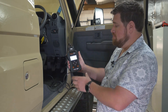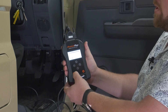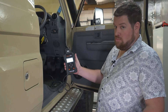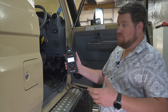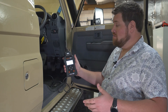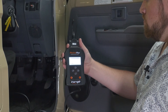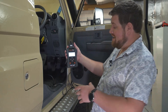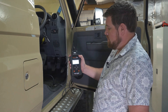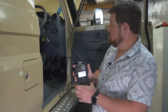The module map is now tuning the vehicle. It will also double check with you that you have switched on your dashboard to the on position with your dash lights showing. When the module map is tuning the vehicle, you may see different lights flash on and off, and you may also hear different beeping sounds and alerts from your car. This is just the module map communicating with your ECU and putting the new parameters in as it needs to do. We've been prompted now that the tune has been added to the vehicle's ECU — switch the dashboard off and select OK. The module map now says that it's writing your ECU and that it's completed. We're back to the main menu so we can now disconnect this and see how much power we've got.